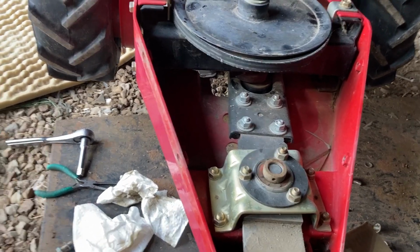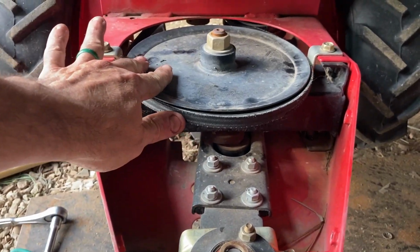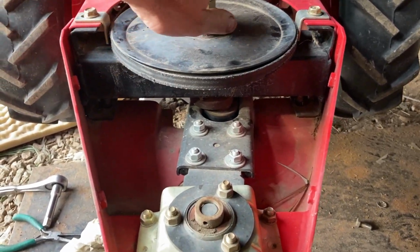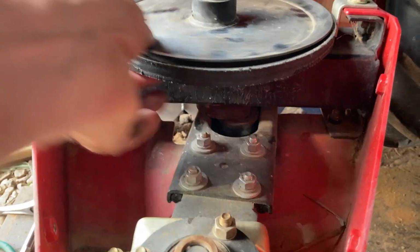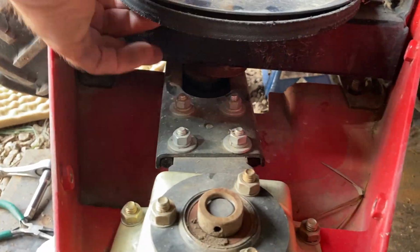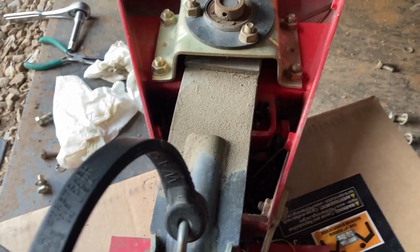So in search of our Zerk fittings, I can explain to you how the machine works. So this plate is motor driven, and when you engage the sickle bar, you engage this belt, and it turns, and as you can see down here, there's a little eccentric guy, and it slips back and forth in that groove and causes this bar to go back and forth.